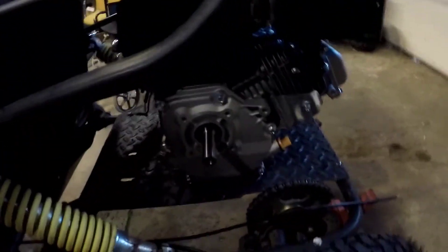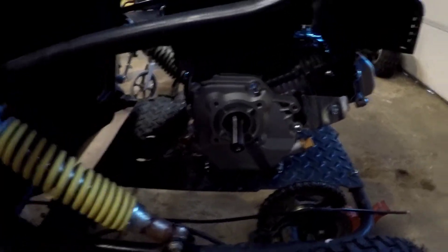We're still waiting on the torque converter so we can get it all bolted down and ready to go. Hopefully this thing is going to be pretty fast — the Predator motor by itself is fast, but with the governor taken off you go from 3,500 RPMs to almost 5,000, so you can rev a little higher. With the torque converter you'll definitely have enough power to just sit there and spin donuts if you wanted to.